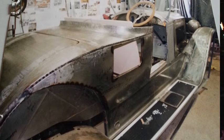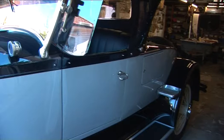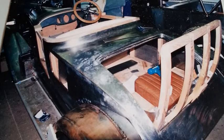And then I had to start on the rear section, the actual body from the cowl back didn't exist. There was no body, no doors, no roof, no hood irons, no nothing. And I had to make all that. Door skins, rolled them up at TAFE using the English wheel. The dicky seat lid was another English wheel exercise of rolling the metal, getting shape both ways.